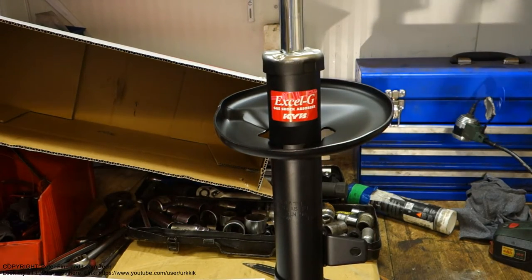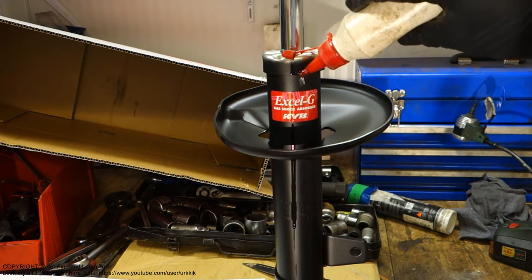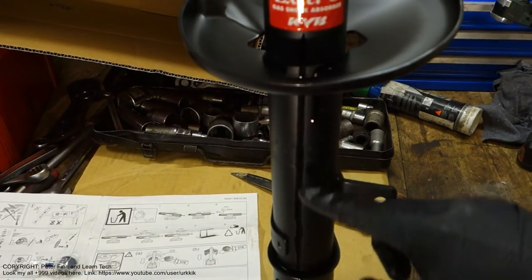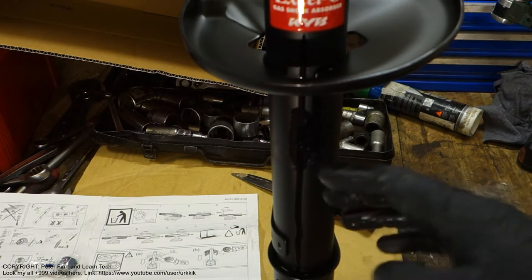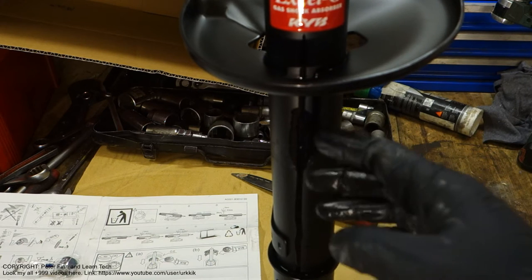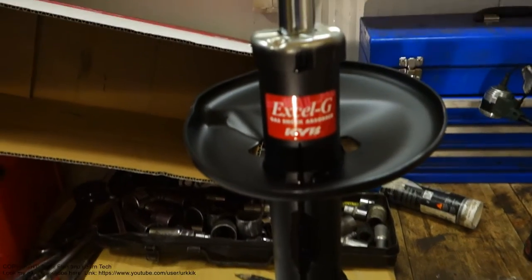And I have engine oil in here, and oily leaks means that the oil is moving in here in that way. And normally when this oil becomes old, the area where this oil is going is black, and it is easy to see when there is something black. All other areas in this shock are normally dry. But when we notice some areas that are black and wet, like oily, then we can right away notice that, hey, now I have an issue in my shock and I need to purchase a new shock, like in that one.